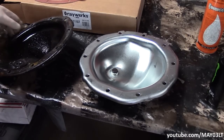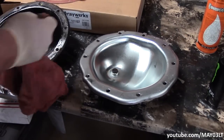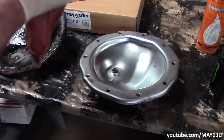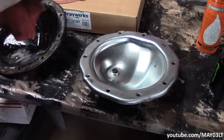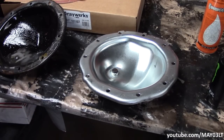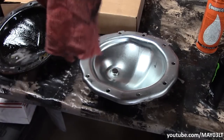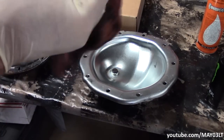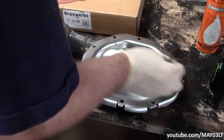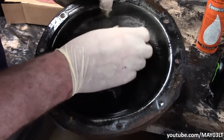Got the new cover and the old one next to each other. Here's the magnet in the old one — I want to use it in the new one because they put this magnet in here for a reason. Just take a rag and wipe the metal debris off of it. This one's actually a little bit bendable, which is weird. After cleaning it with brake clean, I notice it can move around in the pan, but then again it could move in the original one too.